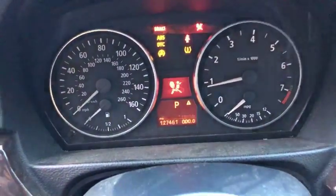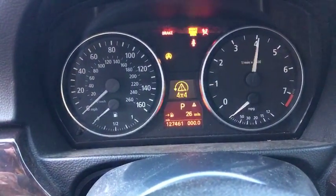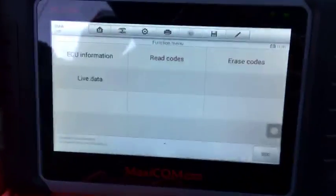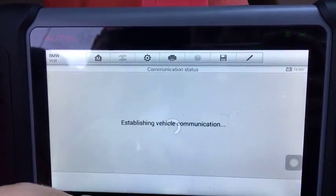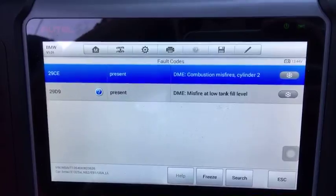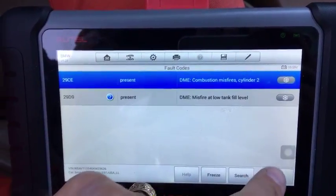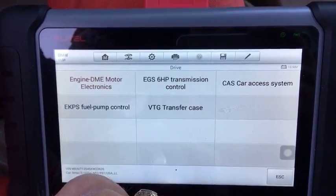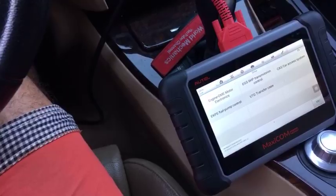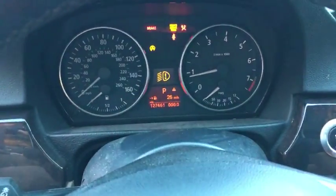The engine light was off because we just reset it — everything is really dirty in here. Engine light is on again. Let's go back to the scanner and read the codes. Cylinder number two — you see how it changed? That means this ignition coil is bad. Just switch it with another cylinder's ignition coil and you'll know if yours needs to be replaced. That way you don't waste money — it could also be a spark plug, low compression, or other issues. Thanks for watching, please subscribe, and many more videos to come.